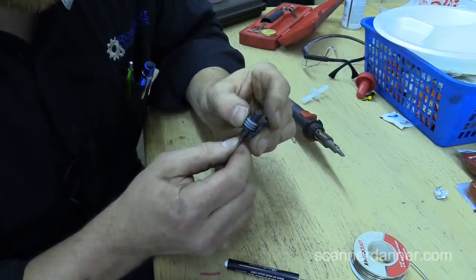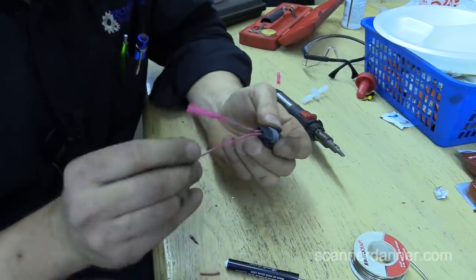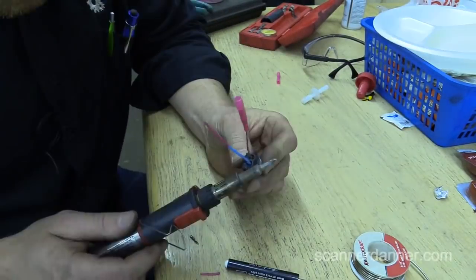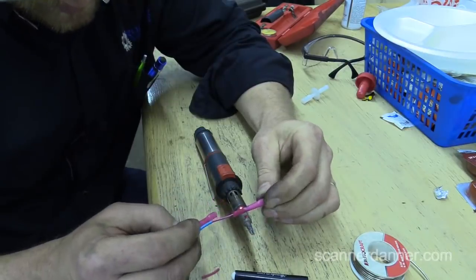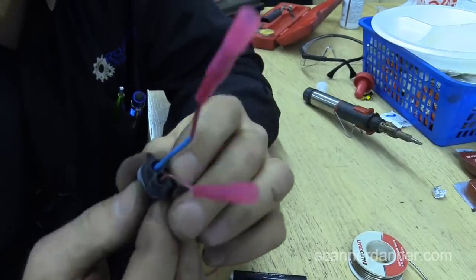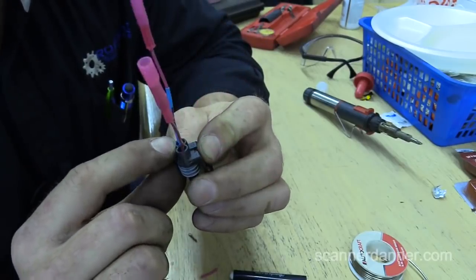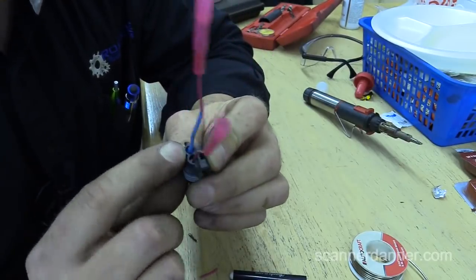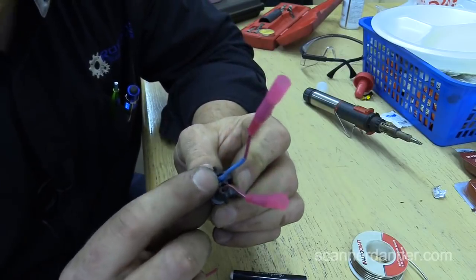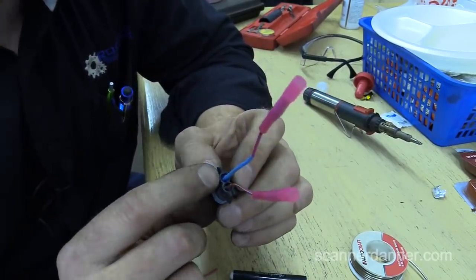Just push that through — there, we have one repaired connector. The only issue now is I've got some bare wire right there, so I'm going to use a little piece of heat shrink. Let me get you a shot of the inside of that — I'm actually going to put some sealer inside of that, in fact I'll do it with both. You saw what happened — it corroded. We get any water in here, we're going to cause corrosion again. It'll take a couple of years, but we still want to prevent that.